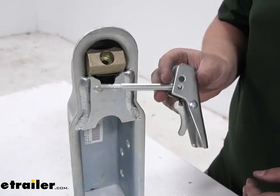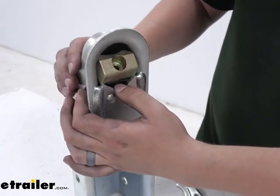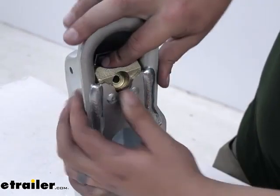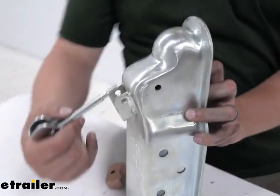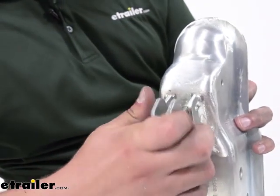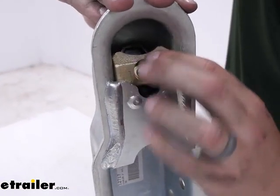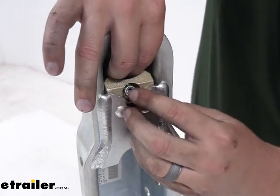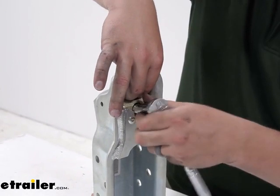After some trial and error, I actually removed the latch because it seems like it's getting in the way. So we've got the spring back there with the black plastic piece in the large block. Compress it in and get this to push down about level right there. Hold it in place with your pointer finger and get this threaded piece to pass through. And on the other side, there it is — we've got it popping out where it should be. All I've got to do now is add the nut and tighten it down with a half-inch socket.